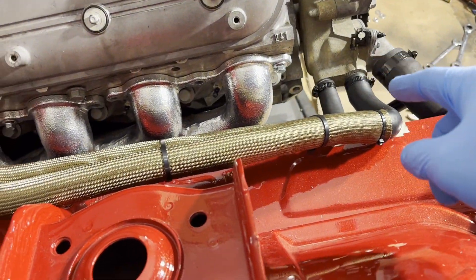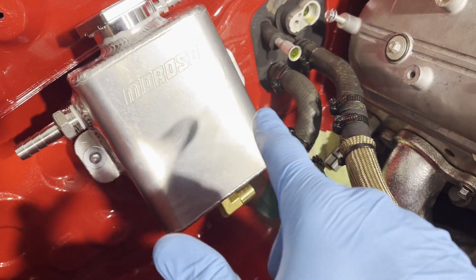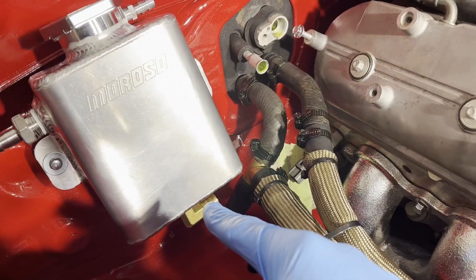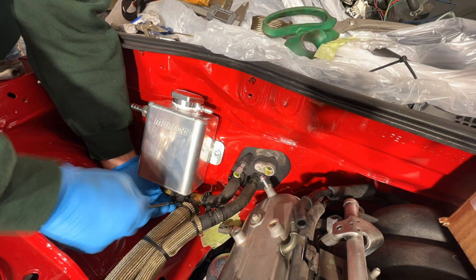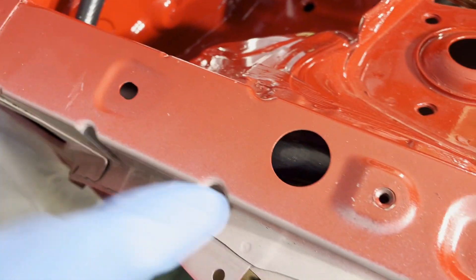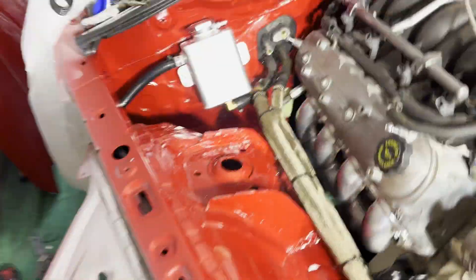Now that you have the inlet running to the upper heater core hose and the outlet running to the lower heater core hose, this is where your inlet to the engine actually splits off to your expansion tank. That basically allows coolant to go up into your expansion tank if it gets too hot and expands and the volume increases. It's going to split off, go into the bottom of our expansion tank, and then this hose here is going to reach around to our top nipple on the radiator. I actually ran it up into this little pocket in here and then it comes out up at the front, so this hose will run underneath and be hidden from the back to the front.